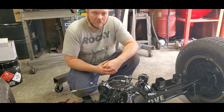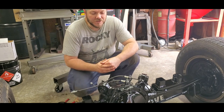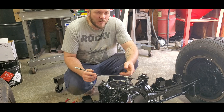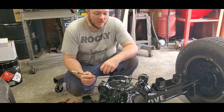Basically, I'm trying to help him organize a catalog so you guys can just call and say, hey, I got a big body, I need 16-inch brake lines, instead of trying to figure out what fitting goes on what end, what goes with what car. Cadillac big bodies — they got weird brake lines. They got a little bubble flare thing, but he's got the stuff that can work with it.